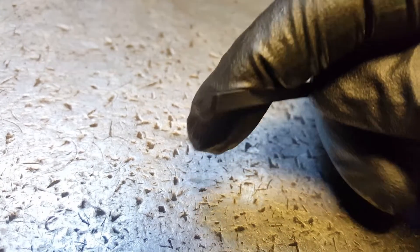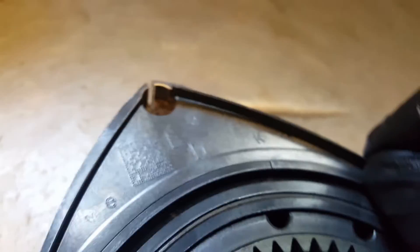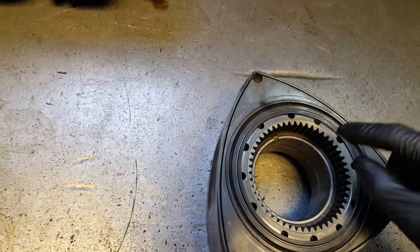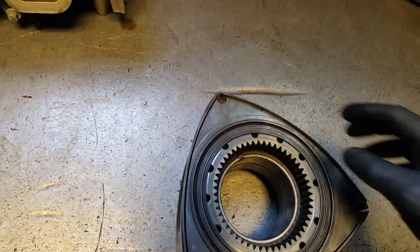You see that angle right there? The little angle — this one has that angle because when you go in here on your rotor, you have it in here and you see the circle shape of your corner seal. That's why you need that shape, so it goes in here and it really has the shape of the corner seal. This side goes right there, and you always have to be measuring it — you're gonna have your corners in place and then you're gonna be filing it down, always checking in there. You're gonna need your feeler gauge to make sure it's on the specifications.